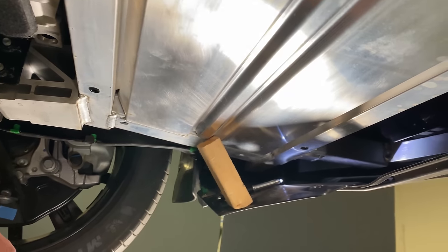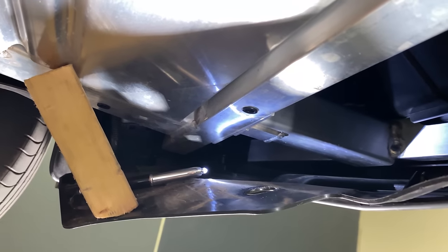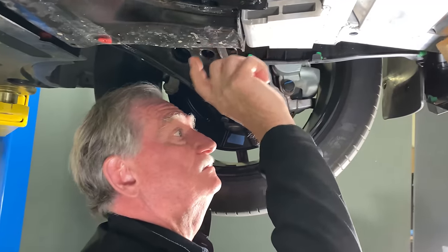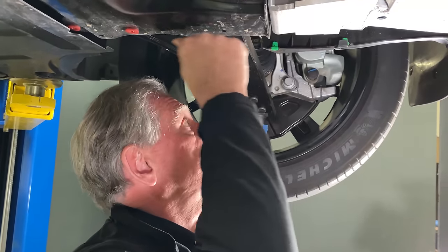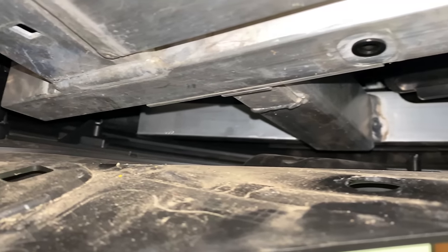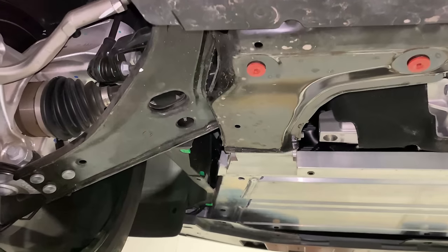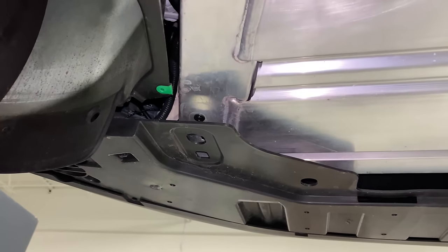the reason that I'm kind of intrigued about how this thing is working is because if we look inside, we can see that this great big giant welded extrusion part is being directed right into the main longitudinal. The main carriage. Now the carriage is going to cam it back and it's going to go right into the longitudinal, so that carries the load in this direction. And then you can see that the bumper beam swings out, and I'm pretty sure that right here what we're seeing is this line of action, which is going to give me the 27 degrees of offset that I need in order to make certain that this wheel doesn't come in and crush you.